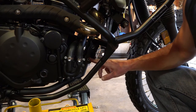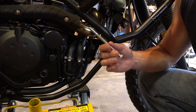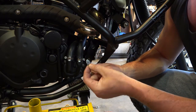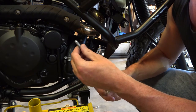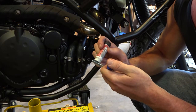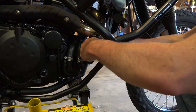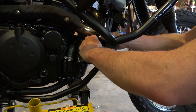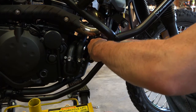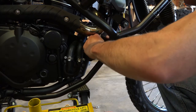Now I'm going to install the front two mount bolts into the frame. This time we've got the two long bolts, two small spacers, and the larger size washers. I'm going to slip a washer onto the bolt first, apply a medium-strength thread locker to the threads, and then the spacer is going to go between the SW Motech crash bar and the original skid plate mount. You may have to fidget with this a little bit to get the alignment and get that bolt through that hole.